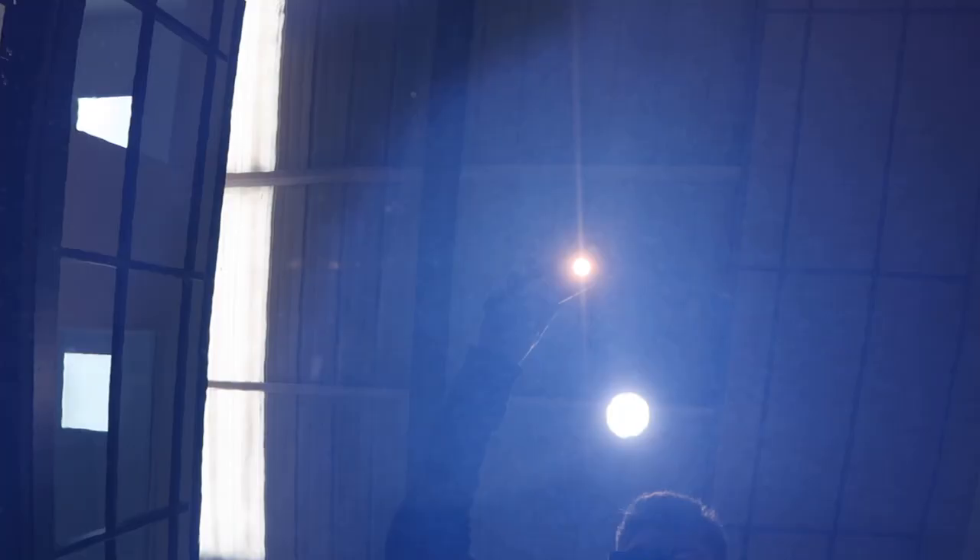The defects were actually so bad I've had to do a two-stage polish, so I'm cutting on the bonnet here. You can see it's hazy compared to here where it's a lot glossier, but once I refine this it'll look a lot better. Very annoying, but the marks just aren't coming out with a single stage, so it needs a bit more.